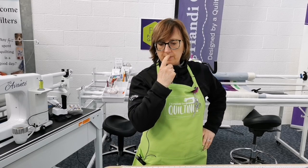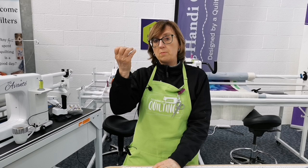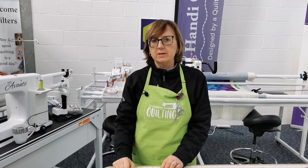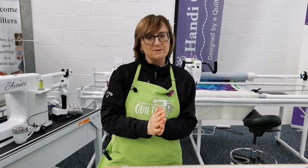Claire's question: what problems does bobbin distortion cause? It causes irregular sewing — tension is okay, then it jams. When it jams suddenly, the bobbin thread tension goes extremely strong, pulling the top thread down, giving you a straight line of bobbin thread without it looking like it's sewing properly. It looks like the top thread tension is the issue, but it's actually the bobbin. It's really difficult to diagnose — we nearly got to the point of replacing the hook assembly before we figured it out.